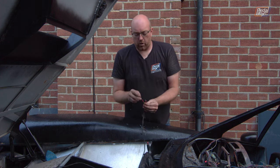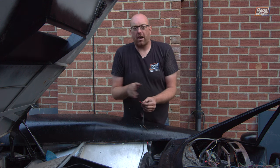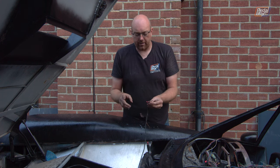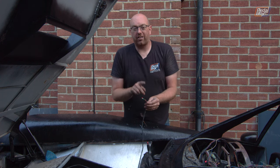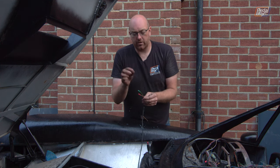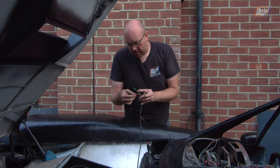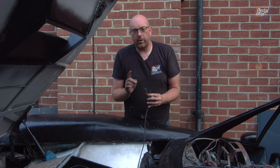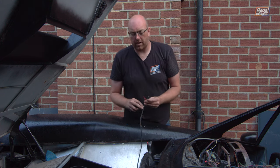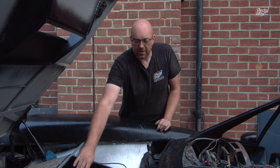Now, unfortunately, we don't know of the two power lines, high and low, which way around they are. They're not indicated on the wiring diagram we actually have. So if you happen to know what color is what, we know that green with black is the intermittent, that goes into the intermittent wiper relay, but there is violet with green and green with yellow, and we're not sure which one is which, so we haven't wired it into the proper plug yet. Also, we can't find the plug at the moment, so we're just going to leave them for the time being and move on.